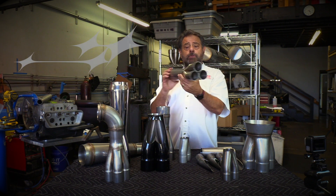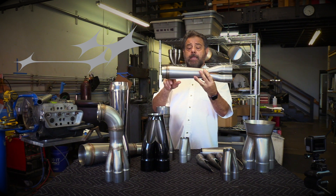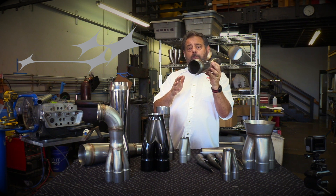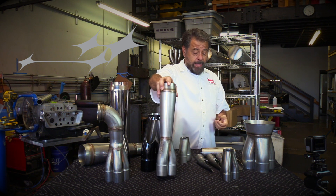Another one — this is a three into one. This is actually a collector from a Porsche 911. And you can see again, this would be a road-going car, but because it's running an open header on a race car, this would be an appropriate configuration for that.